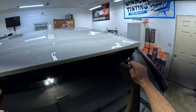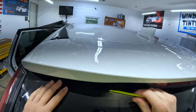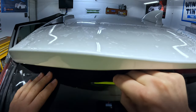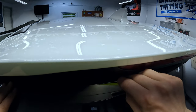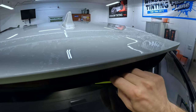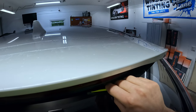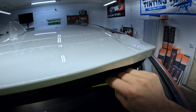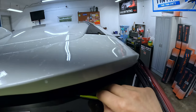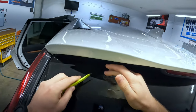If you're having trouble up here, you can easily Sharpie this, drop your pattern down, and cut it. I'm just a glutton for punishment, so we'll just try to do it this way. You could also stick this on the inside of the window and cut it if you wanted, but you've got to be really careful because you can scratch that ceramic black border. It will scratch, and if you scratch it, you'll have a light gap — you'll be able to see daylight through it.